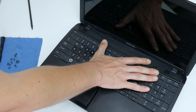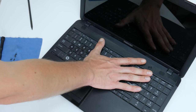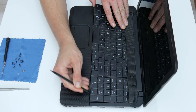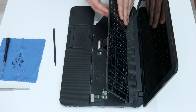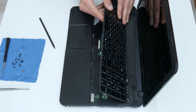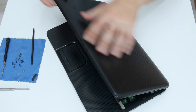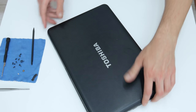Now I will turn the laptop over, very carefully to not break it, and I will remove the keyboard. The keyboard is connected to the motherboard and I simply cannot remove the motherboard with the keyboard still connected. Now I will turn the laptop to the back side again and continue removing all other components.